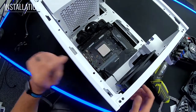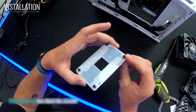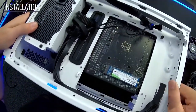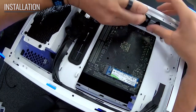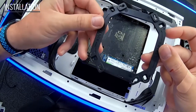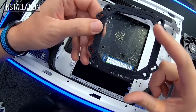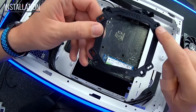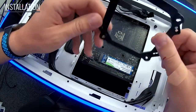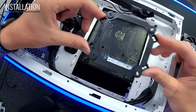Once I get the last one out my backplate's going to fall, and then I'm going to have my four exposed holes. So here's my AMD stock backplate. We have our backplate removed — you can see on the backplate it's going to say AMD on one side and Intel on the other. One of the easier ways to tell is that the recessed points for Intel are more of a square pattern, and when you flip it over for AMD you'll notice it's more of a rectangle with four points.